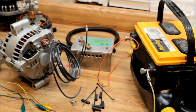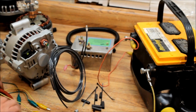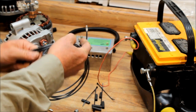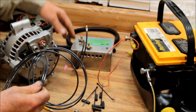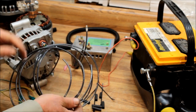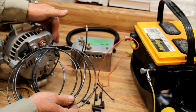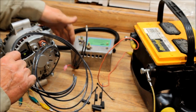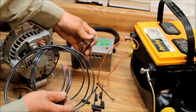You've got to hook these alternators up in a certain way. When you get this alternator, you're going to want to clip the ties that hold the coil of wire in the back. These are generic instructions that apply to all the dual and triple bridge rectifiers. You'll notice there are three wires coming out of the alternator — what we're actually doing is tapping into the AC lines right where they go into the bridge rectifier inside the alternator. You need to hook up these two rectifiers in parallel for them to work together.